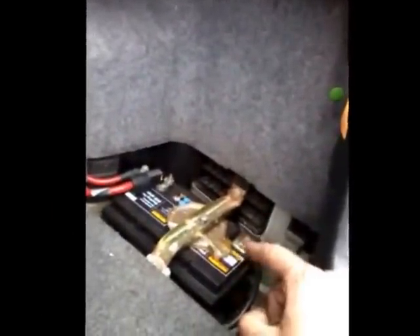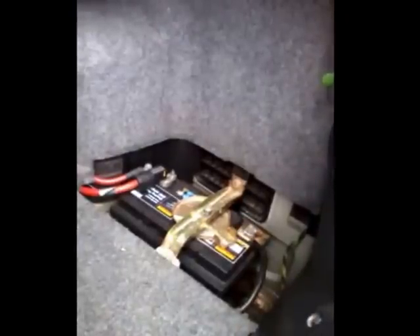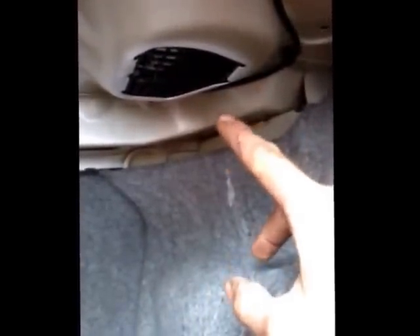Just another note that might be handy to know: because the battery is in the back of the car, it started raining so I closed the tailgate — and it locked, with the battery still disconnected. So I couldn't get the tailgate open again because it runs on a solenoid. What I had to do was go in the back seat and take out the speaker which is just here — take the speaker out completely from the back seat with just a screwdriver and a socket, reach in through this hole from the back, and push the release lever, and that released the back seat so I could get in and reconnect the battery. So if that ever happens, you can get in through the speaker hole — because I've heard of people having to drill holes in the tailgate or cut holes in the back seat. Going through the speaker hole you can release the seat.